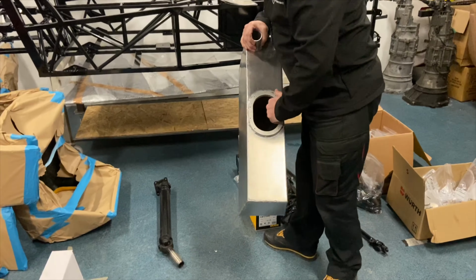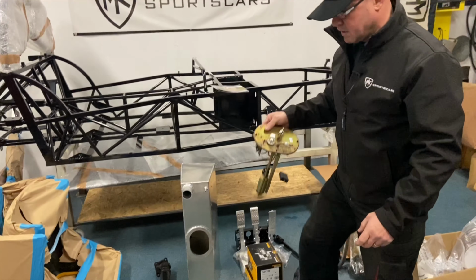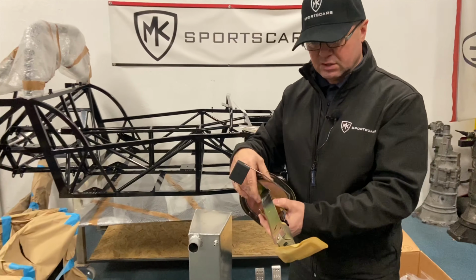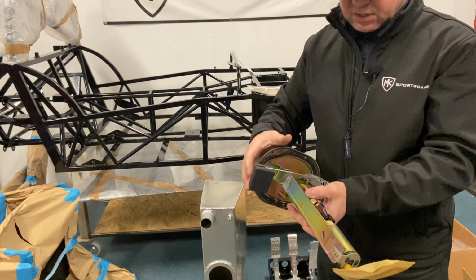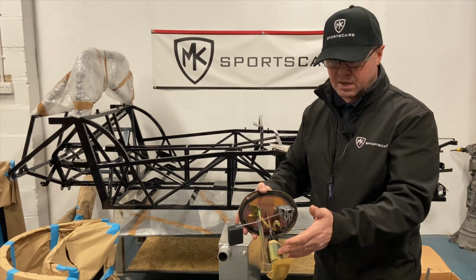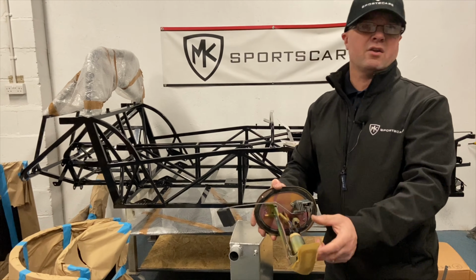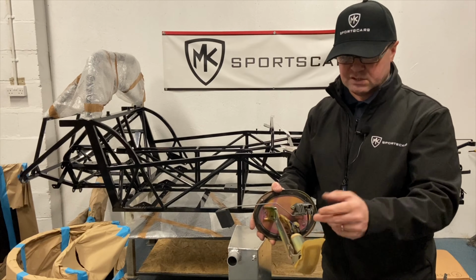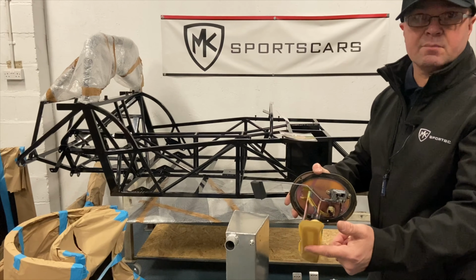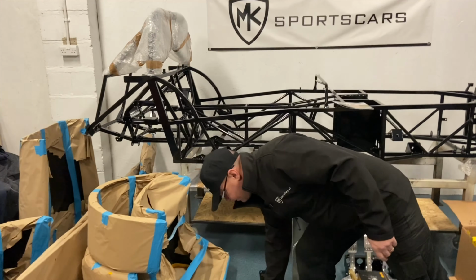The fuel pump that I was talking about, we use the Mazda MX-5 ones to retain the Mazda MX-5. That's modified. That is in the manual. We can do that for you if you want us to. We've done this one for Chris. Again, just give us a shout, but it's in the manual, and that retains also the fuel level sender if you're using the standard gauges, the standard pump. If you're going turbo, you can still maintain all of this, because you can run this up to a Walbro 190 or 255 pump as well, so that's exchange as well. It comes with basically the filter that sits right in the bottom of the sump, so it's perfect for fuel surge.